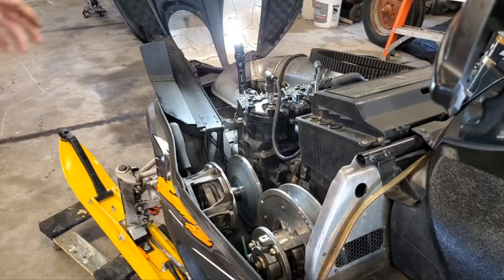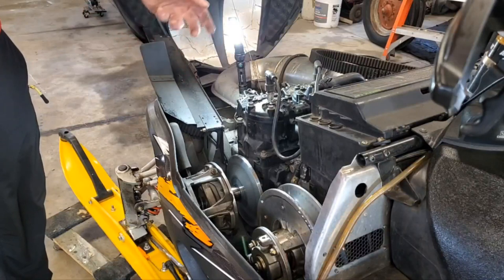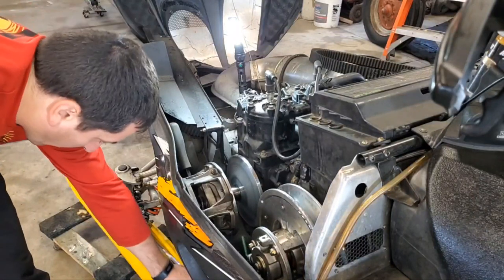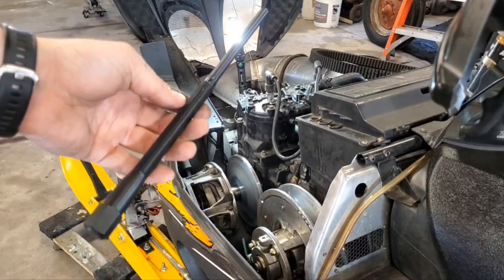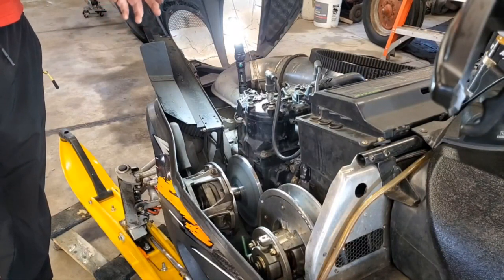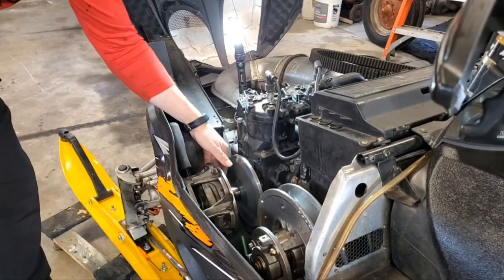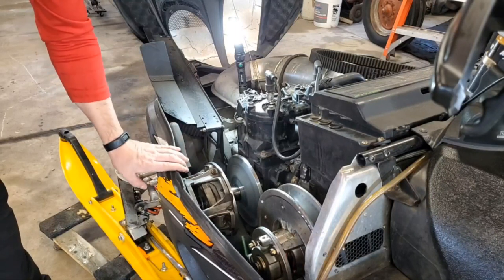Okay, now, unlike the secondary, where there's a keyway on there, the primary is on a tapered shaft. So in order to get that bad boy off, you're gonna need a puller. So here's what your puller looks like. I can put the part numbers in the description, but basically you have to know what kind of clutch you have. So I know my clutch isn't original because I replaced it. The original clutches on these are a 9-tower clutch, and they are known for spider webbing and breaking inside here. So I went ahead and I replaced mine a couple years ago with a 6-tower clutch, okay?